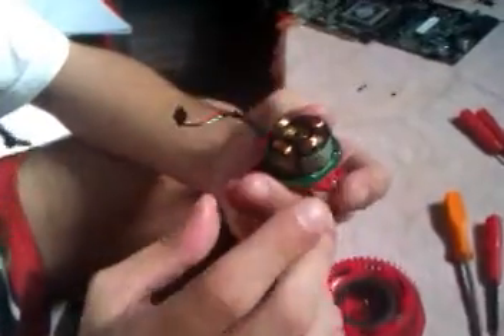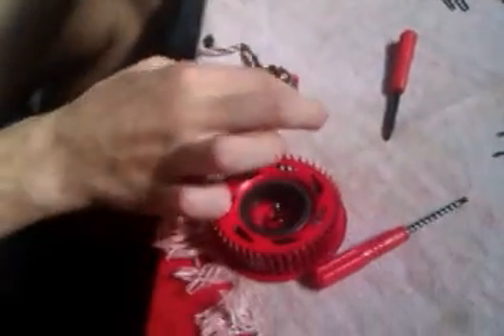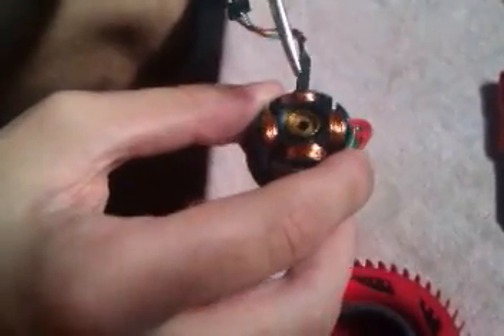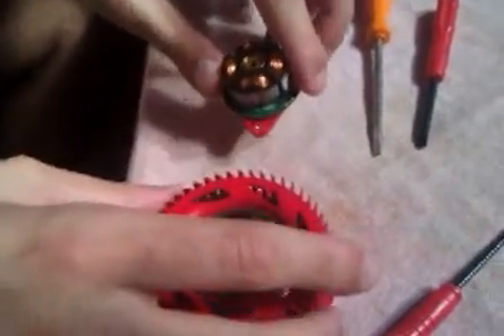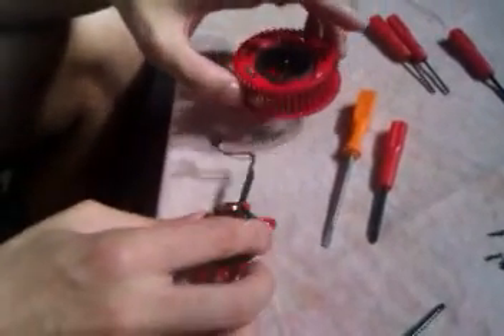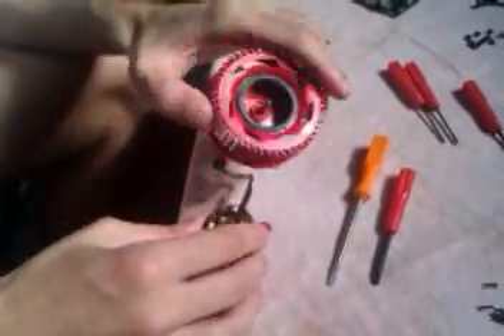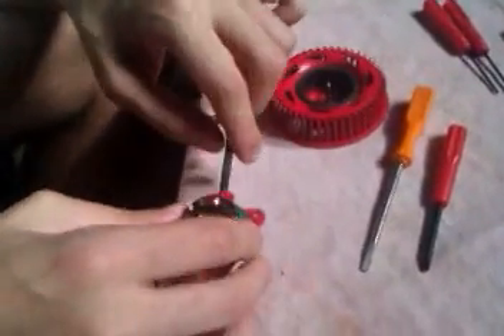Magnetic thing. I'm not a fan expert, but I managed to open this one up. As you can see, these two parts are the cause of our problems with this card. When these fans are rotating at high speeds, this part tends to get eaten up by the other. Lubing it up would help, but since I didn't know how to lube it when I first opened my card, I lost this fan. It does spin and it doesn't make the rattle sound because I lubed it up, but it's still vibrating and I don't like things vibrating in my case.